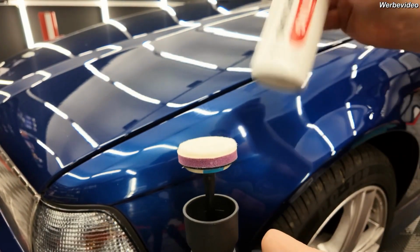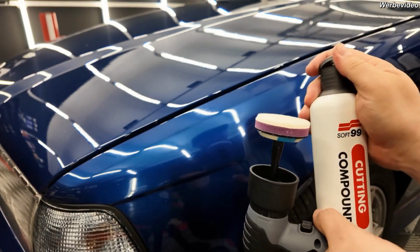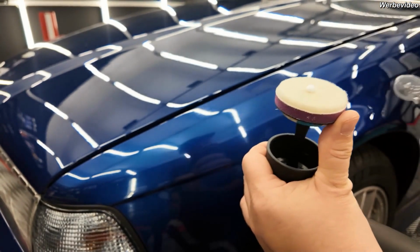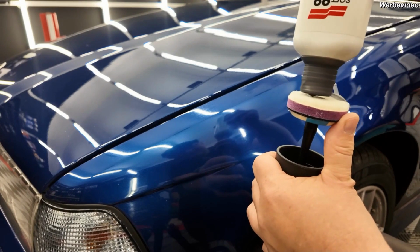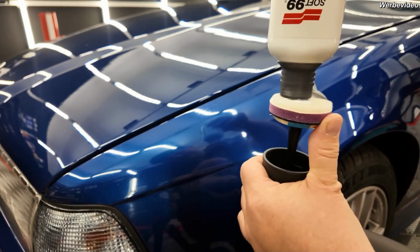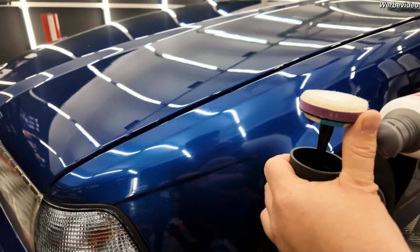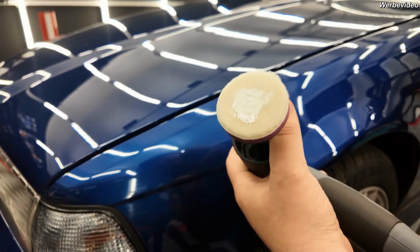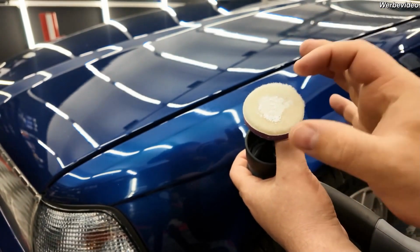We take a bit of polish here, and since we just saw that the scratches are very, very extreme, we take a little polish, and you see, I'm using very, very little. You now have two options. Either you apply it directly with the bottle on the surface, just press a little bit on here. If a little extra comes out, that's no problem at all. Press it a bit into these small fibers, close the bottle again, and now you have distributed everything here, in quotation marks, centrally in the pad, because the polish moves outward on its own.